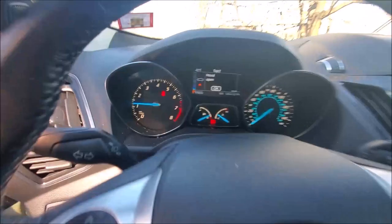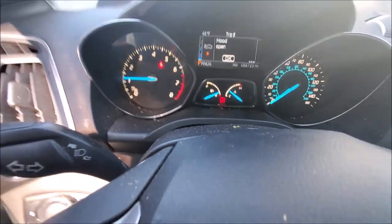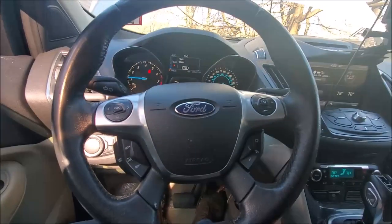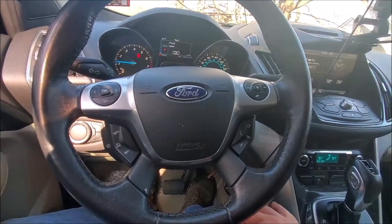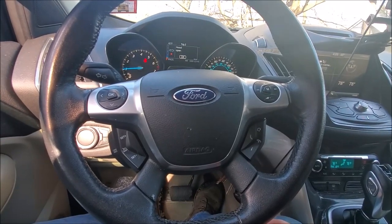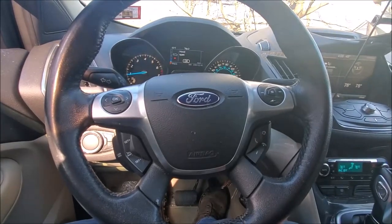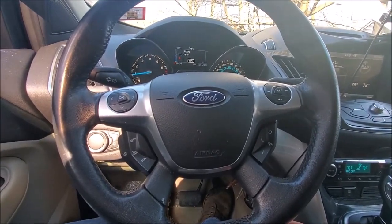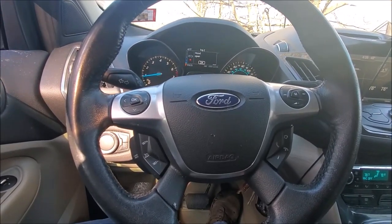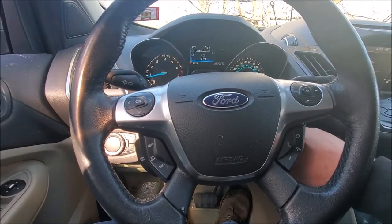You can see it's fairly cold — the temperature. We don't have any leaks and we know we've got at least enough oil in there to run it safely. So we're going to give it a minute to warm up, fill that filter good, and also the oil will run back down into the pan so we can check the level better. But we have it on the ramps — we have to take it off the ramps to finalize the check. You want it parked on a level flat surface, or you're going to get a high or low reading.